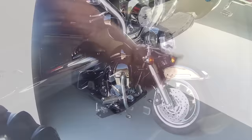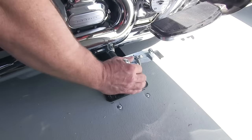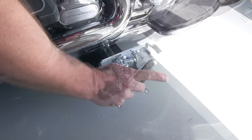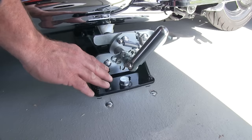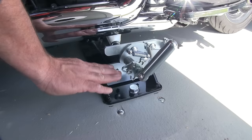It's a simple design. It's going to attach at two points to your motorcycle — two clamps around the frame that are neoprene coated to protect your frame — and it's going to tighten up on this handle right here, which is what tightens up your bracket. If you're hauling this on an open trailer, it has a point where you can attach a padlock to secure the clamp to the bike, and there's also a position for a padlock on this side that will secure your bar to the bracket. The idea is that once clamped to the bracket and mounted securely to the floor, this becomes an extension of the suspension of your trailer, so your motorcycle will have a slightly compressed suspension and use your trailer suspension to stay secure as you go down the road.